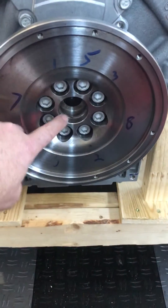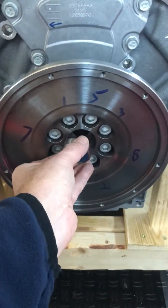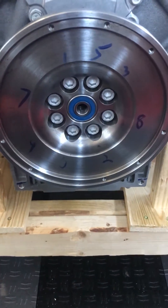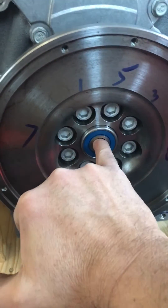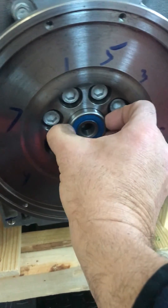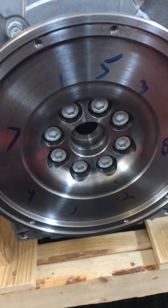Basically, in this area here, you insert a pilot bearing — I'm going to put it in here now — and the pilot bearing holds up the transmission shaft. The issue I'm dealing with is this pilot bearing is just a tad loose. It really should be a press fit, and this is called a loose or a slip fit. There are a number of ways to deal with this issue.